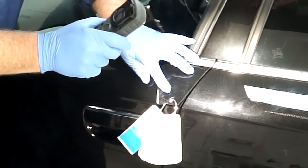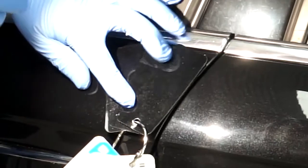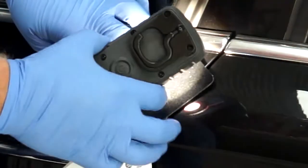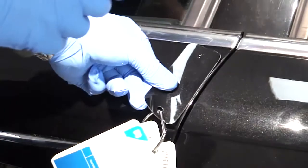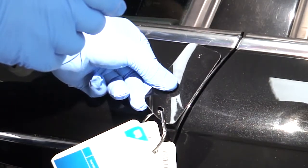Different light sources can affect the colour matching process. It's recommended that a daylight lamp is used to identify the true colour. The face tone and the colour on the angles should be checked if it's a pearl or metallic.